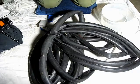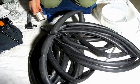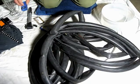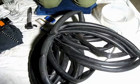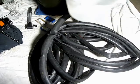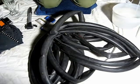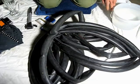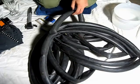I'm not going to talk about it too much, because it's fairly straightforward. Tools you'll need for this are a bike pump and a patch kit. I've got several of them here. You might want a bucket of water. Now, I don't know if we'll actually use the bucket of water. I'm actually hoping we won't have to, because if you don't have to, it's usually cleaner that way. Yeah, because then you don't have to dry the tubes before you prep and apply the patch.